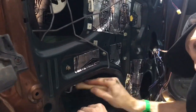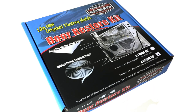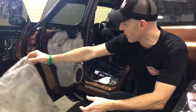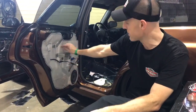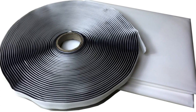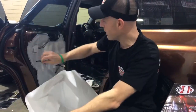I'll just show you the rear door which we've done. So you can see here, we've gone and put our door restore kit in it. Now you can see this was the original plastic that's been on and off a few times and it deteriorates pretty quick. So our door restore kit — we've put our dampening sheets on there underneath, there you can see them. And then we've put our sealant tape around and universally got our plastic, which is this here, oversize that and then cut it around.